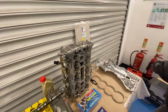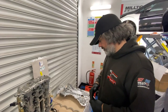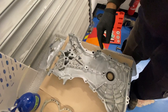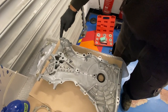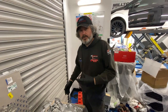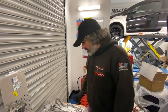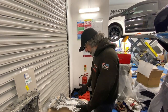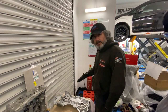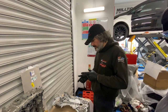The valves have all been cleaned and lapped back in — that part is all done. The chain cover, which is where it was leaking, is all clean and prepped, which is what the dealer should have done. Prep the block, prep the part of the head where it makes contact, and then apply the sealant correctly — not over the face, but around the inner part.